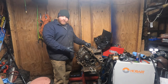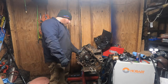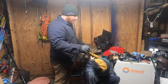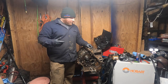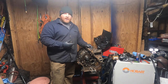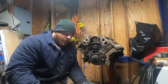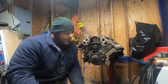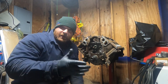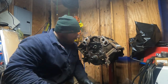It's another day — we've got to get a cam in this thing. The rotating assembly is done. I want to be able to feed the cam in through the bottom while it's inverted. We're going to lube up the cam, stuff it in, get a timing set on it, and then check cam timing. The cam is installed — I got the batwing retainer in there. We've got the Chop Monster cam from Texas Speed in here. I also preliminarily installed the crank timing gear and have the rest of the timing set ready.